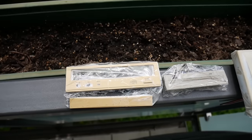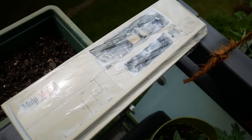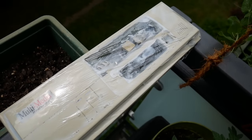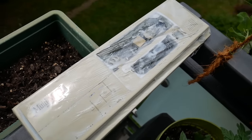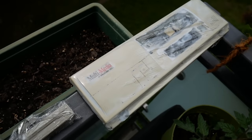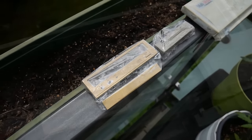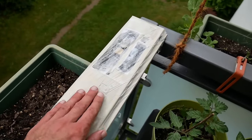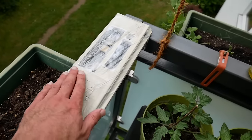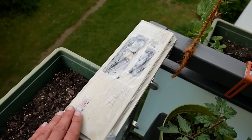For retro brighting, you need warm and sunny days. It took about 4 to 5 hours in direct sun, and I came out every 20 minutes to move the peroxide gel to avoid the marbling effect. That's why it's better to use liquid than gel, because you don't need to move the gel around. Just drop the parts into a transparent container with liquid hydrogen peroxide and take it out after a while. Much easier, but well, I used what I had with all the consequences.